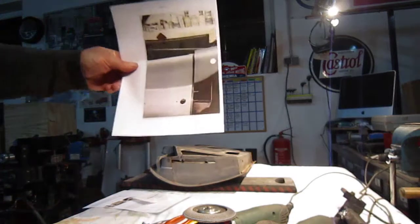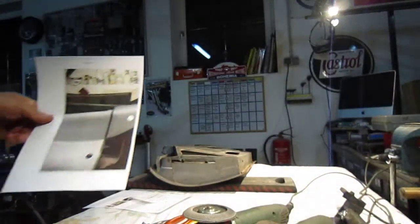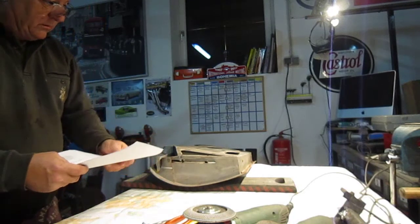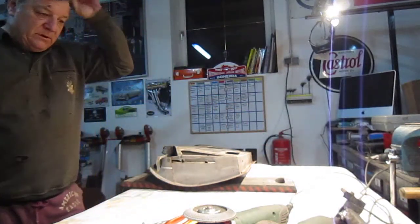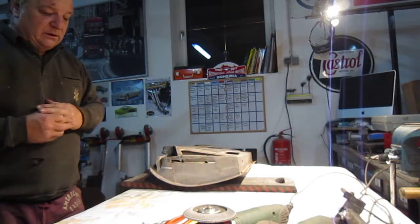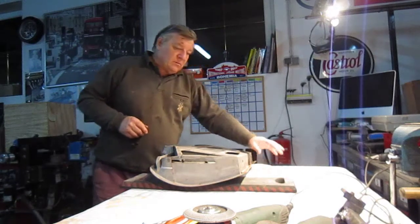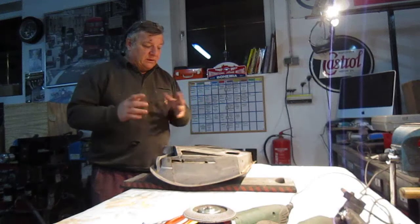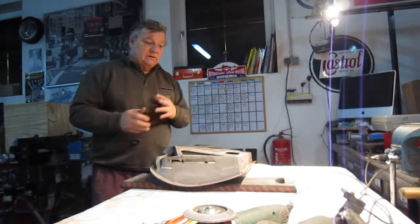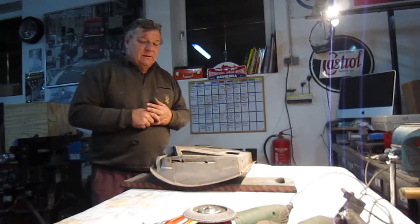I'll show you here — you can see how this is not lining up. It turned out that both the panels were the same — they were incorrect. He bought them from a company; I've seen the picture but I'm not going to mention the company's name. I get most of my parts from Martin Robey and I've been very impressed with the quality of their panels. If you go somewhere cheaper or more expensive, that's the chance you take. What Peter ended up doing is taking the old panel and rebuilding it — the majority of it was quite good, but he thought because of corrosion he'd replace it. You have to look and say, can I get the right panel? Try and get the panels before you cut anything out, because if you don't, you're stuck. Try not to cut too much out before you have the panels to check against.